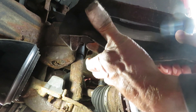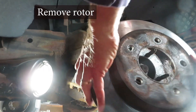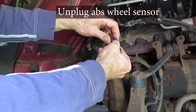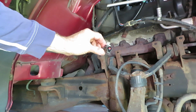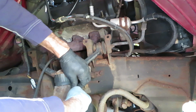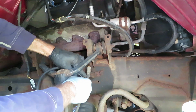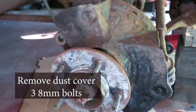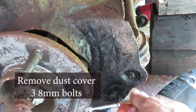With the bracket out of the way, now we can remove the rotor. With that wheel well cover out of the way we can simply unplug it here. I checked for five volts first and it's there. Sensor cabling mounts to the brake hose by some standoffs. Just pull those off there and then the cable's free.